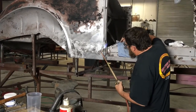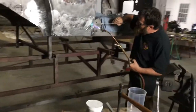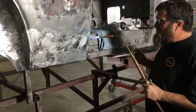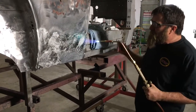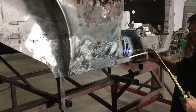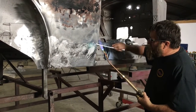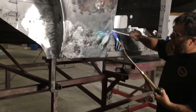Right now, I'm just trying to get a real good etch of lead right into the corner. Already got real good build up, and I'm going to build this whole corner up. That way I got plenty of extra here to file off when I put the skin back on the door. Set the door back in place again. The door's been on and off. Just set it and check some measurements in the hole, and I'm going to make a good extra build up. I'm going to make it nice and plenty to file away and have a good bit to work with.